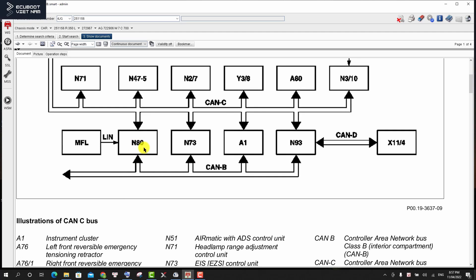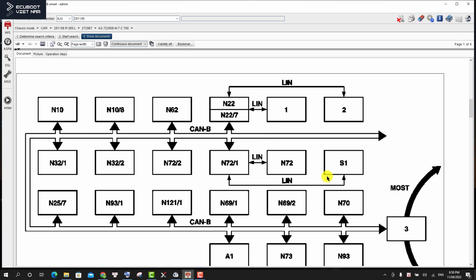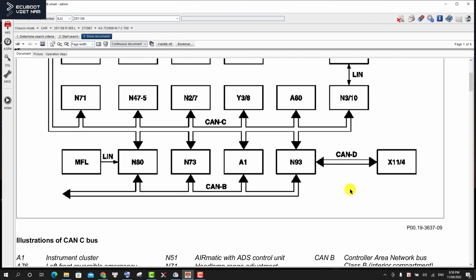There are several modules using two CAN buses at the same time, like the electronic ignition switch, the instrument cluster, and the steering column module. With CAN-B, we have units like the seat, the door, the Parktronic, as well as the front SAM, etc. The most important module is the N93 — the central gateway. A central gateway is a hub that interconnects and transfers data across the many different networks found in a vehicle in a secure, reliable, and dependable manner. The gateway acts as a router and enables communications between multi-protocol and connected services.